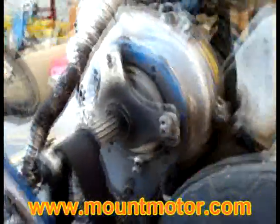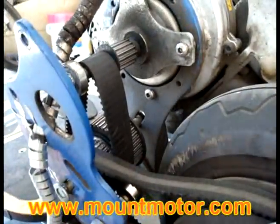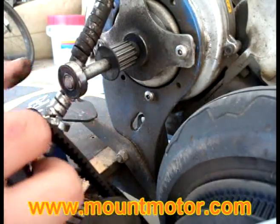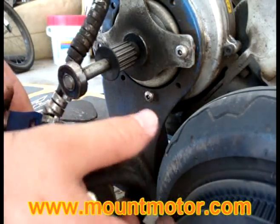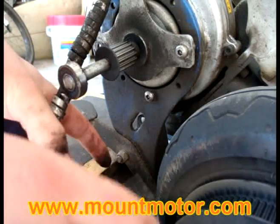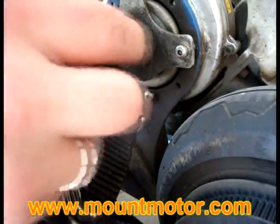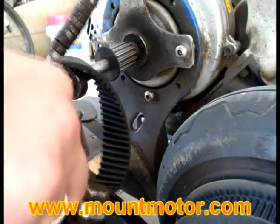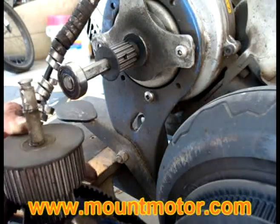Pretty easy right now. We pretty much covered the hard part. Alright. Whole belt assembly has now fallen apart. And now we can remove our clutch belt right here. Make sure that none of the sprockets are misaligned when you put them back on. Alright, see? Now I can already move this belt. Just to move it out of the way here. Like so. Pretty easy thing to do.